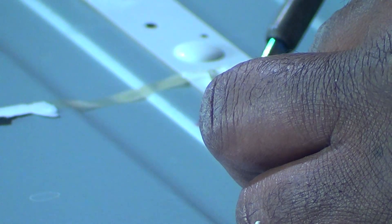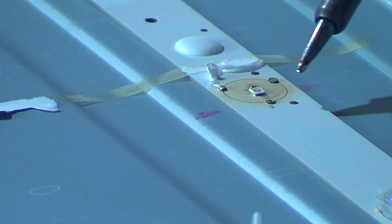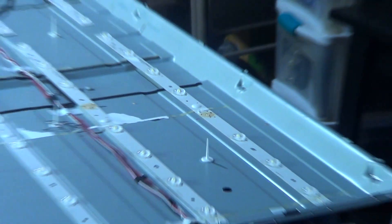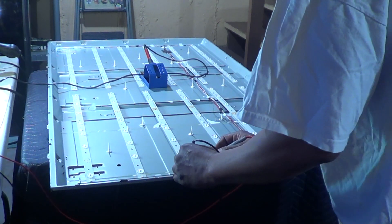I'm going to put some flux on both ends. I've got to scrape one side so it doesn't actually short out with the trace. Just put a little solder on each side and it should stick right on there. It's not going to be perfectly even when you put your LED lens cover on top, so my thing is just light up the whole entire TV once it's fixed, then put the lens cover on so you can see the light is even. I did replace all of those on that one side — as you can see, they are all lit up when I use my LED checker.